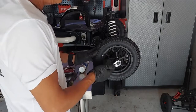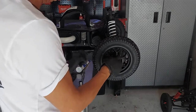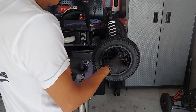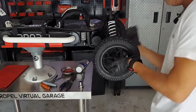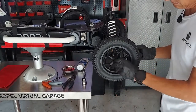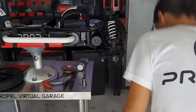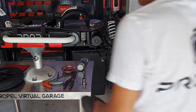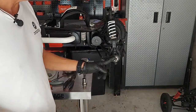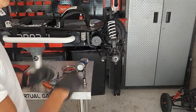Take a 16-millimeter and get that tire off. Be careful to catch your washers when they come off — sometimes the tire needs a little pop. Give it a spin, take your wheel off, collect your washers. This one uses two. Add or subtract washers just enough so you can get your cotter pin to line up with the hole.